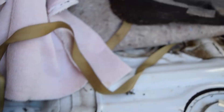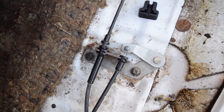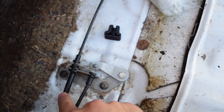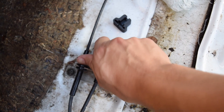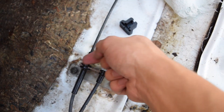So if you push this down and your gas cap doesn't pop, this should be a pretty good fix for you. Here we are in the trunk — I went ahead and removed the tool tray, and right underneath the tool tray is this little latch mechanism. There's a line coming from the front — the line that goes through it is for the hatch, and then there's this mechanism right here that pops the gas lid. If this gets pulled it pops the gas lid, and if the line gets pulled through here it pops the trunk.